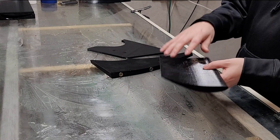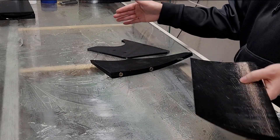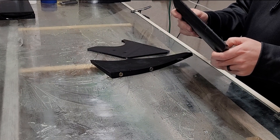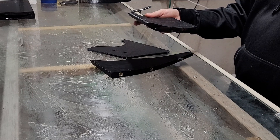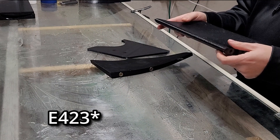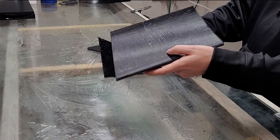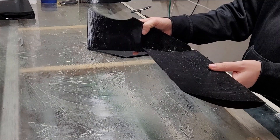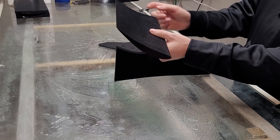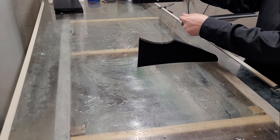These are the three pieces I'm using to make the little winglets that go on the edge of the splitter, to take up the distance between the edge of the splitter and the bumper — right now it's just a big open space. Basically this is like a dive plane, you can think of it as a canard but with a lot more width than normal. It's the same profile as the rear wing — a NACA profile, the E634 or something along those lines — you can get it off the internet for free. This is a center support bracket; it sits and holds it upright, and I don't want to drill into the bumper, so these side mounting holes line up with these side mounting holes.